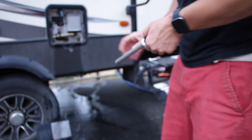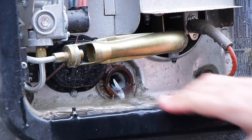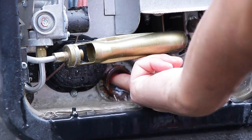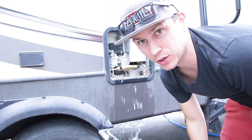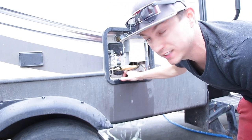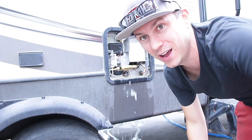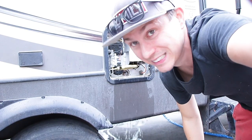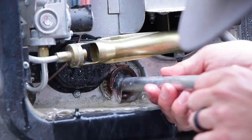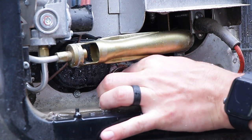Because I haven't drained my water tank, the water is going to keep flowing out until the tank is empty. Also, if you're on city water, you definitely want to turn off your city water, because you'll have pressurized city water shooting out at you. It's one thing to have your tank draining out, but if you have city water pressure shooting out, it's not going to be good. So I'm just going to go ahead and put this in here — I don't need to wait for it to drain all the way.